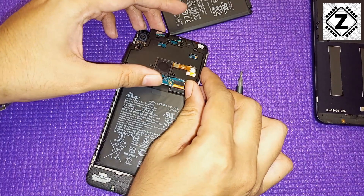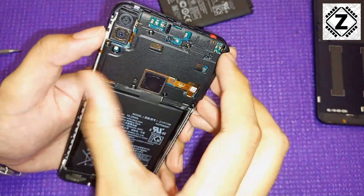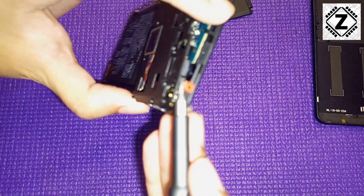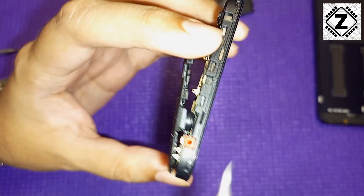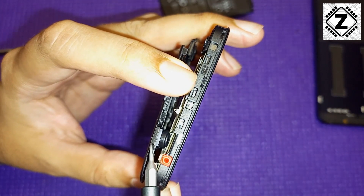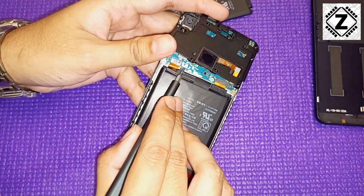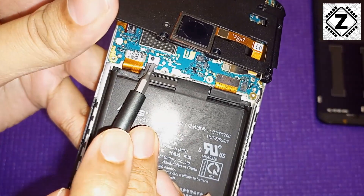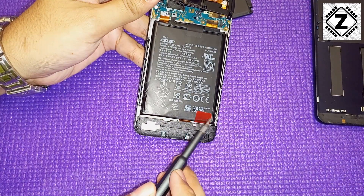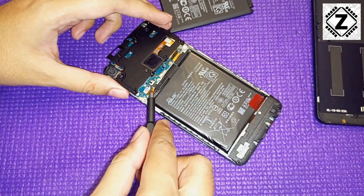If your fingerprint sensor is not working correctly, this is the time to swap it out. The plastic shield is mostly loose but still stuck at one point — the camera appears to be slightly glued to the shield. However, we don't necessarily need to remove the camera because what we need is access to this point right here: the lego-style connector for the battery itself. So we can avoid removing the camera entirely.